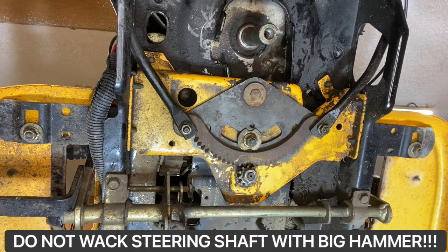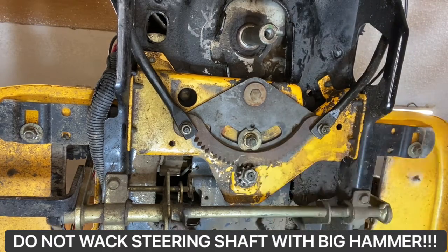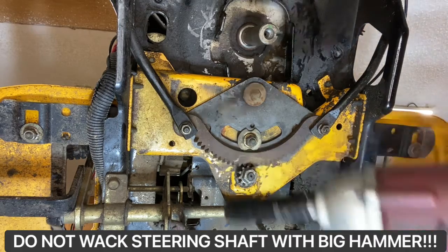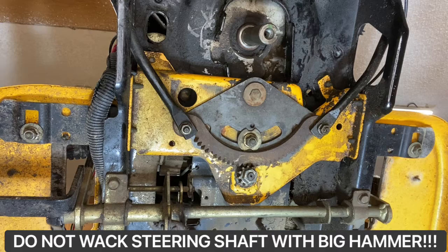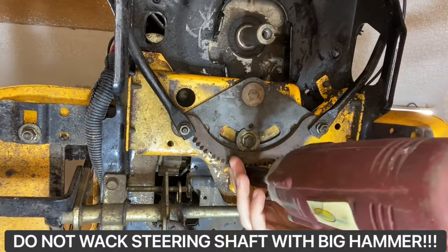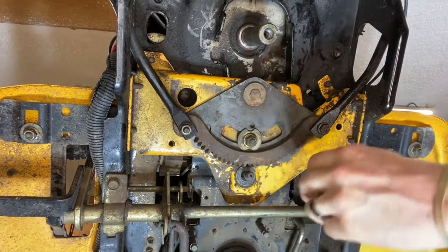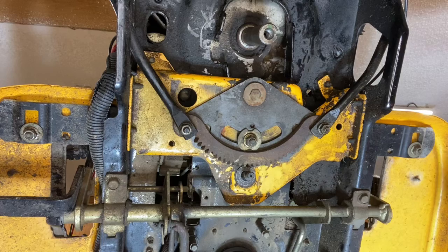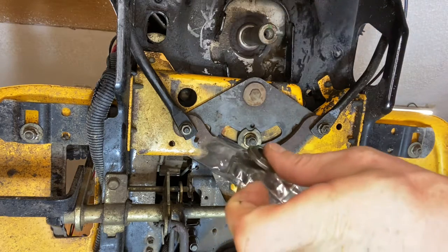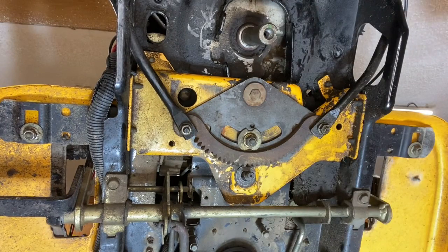What we're going to do first is take off the pinion gear nut. I like using an impact of some sort — just throw it in reverse and make sure you have somebody hold the steering wheel up top if you don't have a way to lock the pinion. Remove that, and then she just slides off like so. This is the pinion gear — it actually looks pretty good. But you'll notice with your new kit, you do get a new pinion gear.